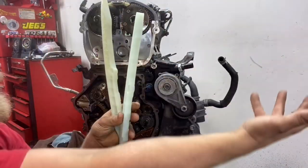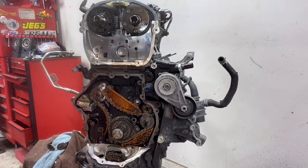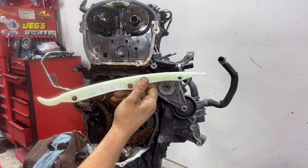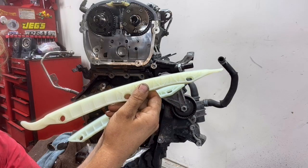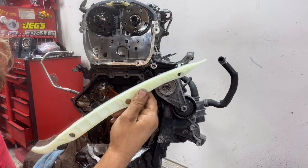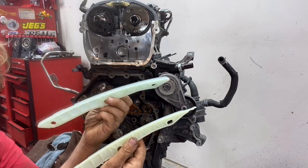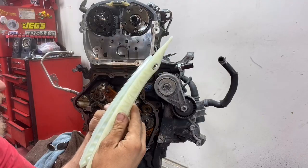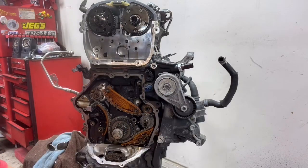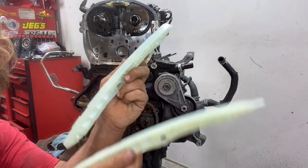On the intake side, this is the intake rail. There's the old style right here and then the updated style is this one right here. Honestly both of them are fine in my opinion. This updated one will guard against going out of time again in the future better because it curls around the chain more with these two lips. But this one's more friendly to mechanics if you want to take it apart and adjust things. The other side never changed — it still looks like this. I'll install this rail because it's the more difficult one and explain as I go.